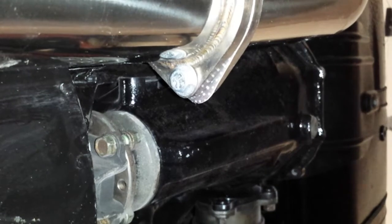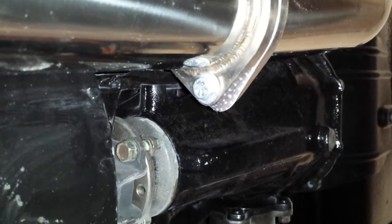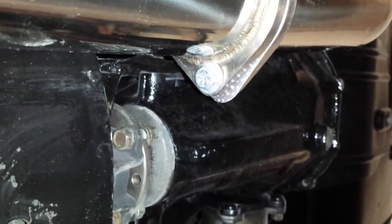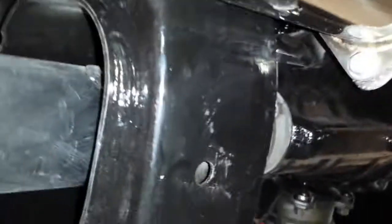Even the thickest Toyota bearings, had we bought them, or carrier shims, would not have been enough. It was still out by a fair bit. We had to have custom shims made for it. And yeah, getting the pinion depth was a pain too, and all that. Took my diff guy quite a while to get it right. It was a tough job, but he did it. So that is about it for drivetrain and suspension, mechanical side of things.